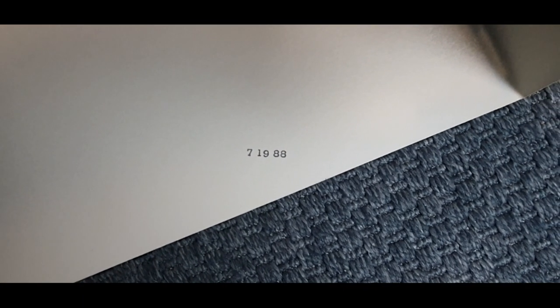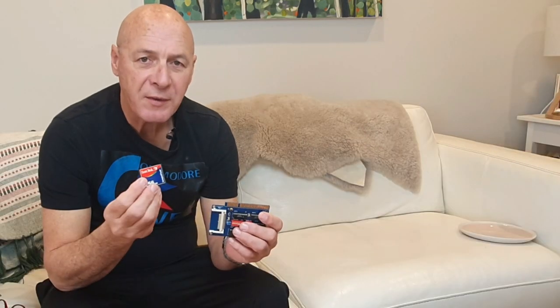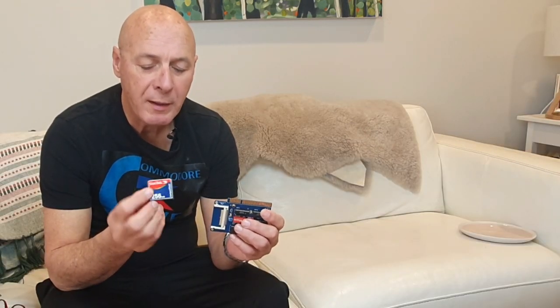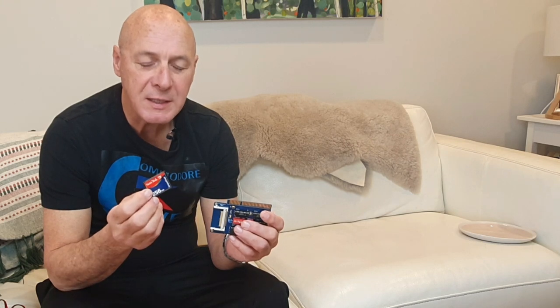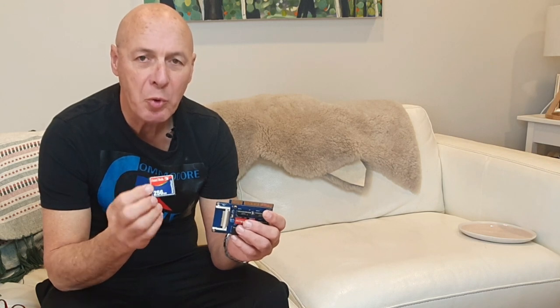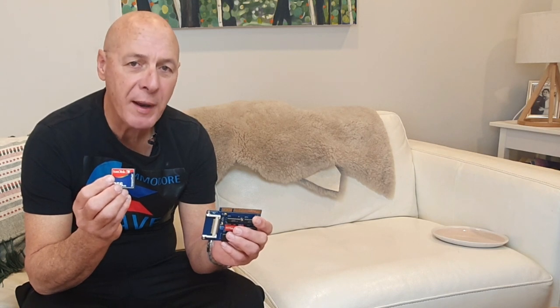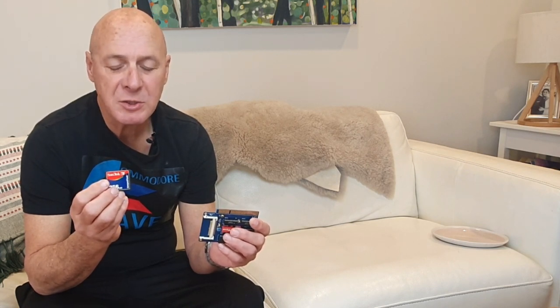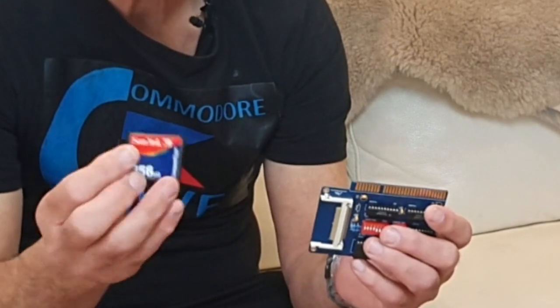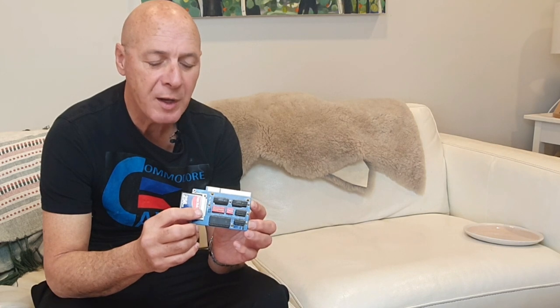I spotted this stamped inside the case. They never came with a hard drive, so I've purchased this ISA compact flash adapter. The CF card is reliable, inexpensive, and quiet. It allows me to have up to eight partition drives on this — 32 megabytes each — which is more than ample for a DOS machine. It also makes it extremely simple to copy programs from my existing desktop computer into the Colt, and I can have multiple CF cards. I got this on eBay delivered to Australia for under $100.